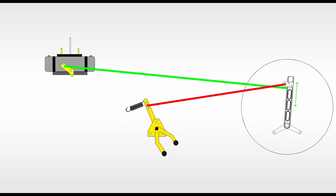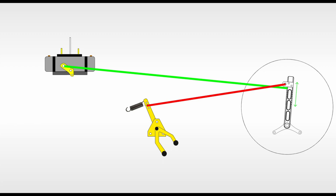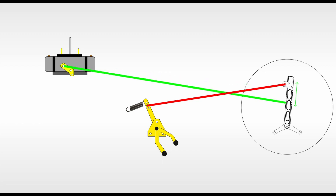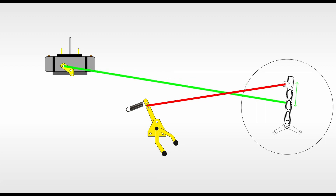Here's a diagram of the general layout. What the TC device does is it introduces a secondary linkage into the throttle system. You can move the green link, which is attached to the carburetor, up and down, and it lessens the motion ratio that the pedal has against the carburetor — very effectively killing power and also being very easy to adjust.